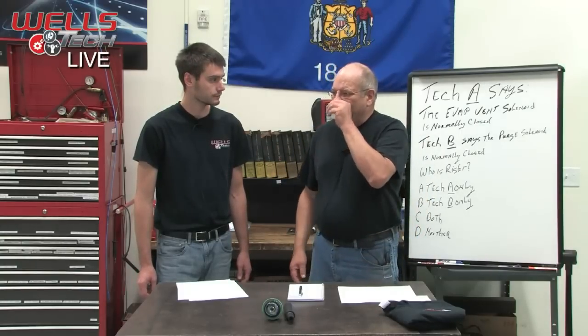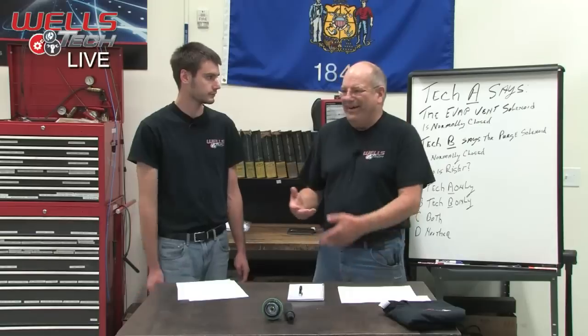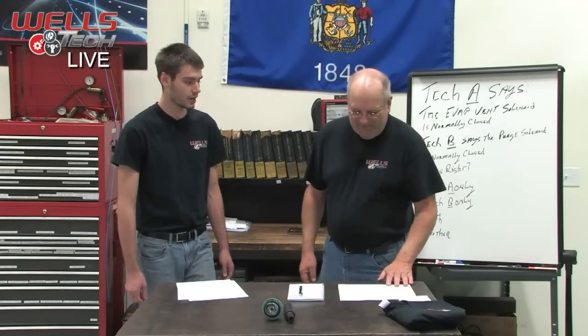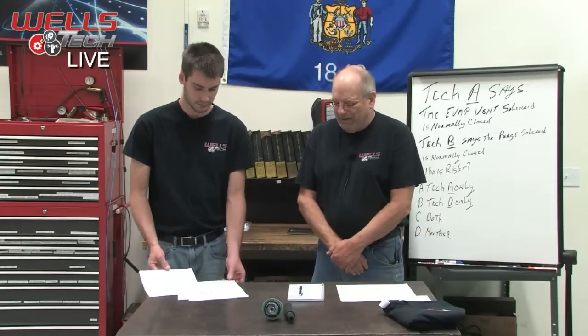So what do you do when you have an emissions test coming up in the middle of winter? You better warm that car up, take it for a test drive, and hope like heck it runs that monitor. We used to leave cars sit in the shop overnight to get them warmed up to temperature and try to get them to run that monitor. It's a real tricky thing.